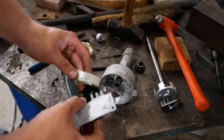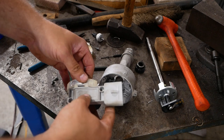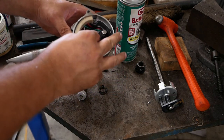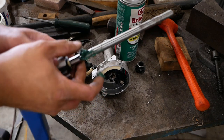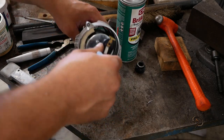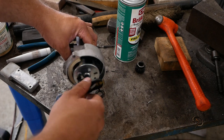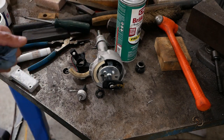There's the new pickup — let's see how it fits. It fits a lot better. We need the little thrust washer and some grease on the shaft. The hall effect sensor should trigger every time it sees the edge of one of these windows, and sometimes there's one narrow post — yeah, there's one right there that's narrow. Now we've got to put the gear back on — that's the fun part.